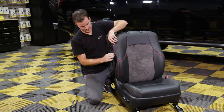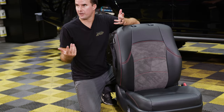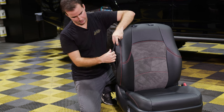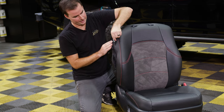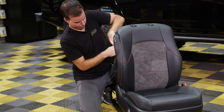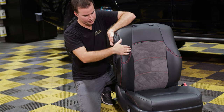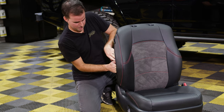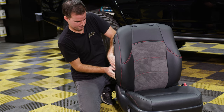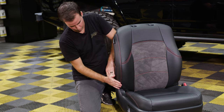The final step on this is the airbag pocket, so the airbag can come out in the event of a side impact. There's a little mesh strip on here with two pockets or sides. You're going to take your fingers and push that mesh over and around the corner on the side of the seat so it kind of stays in place with the top flap going over it. It's usually easiest to start at the top and then work your way down.